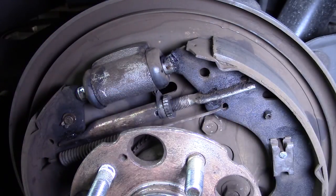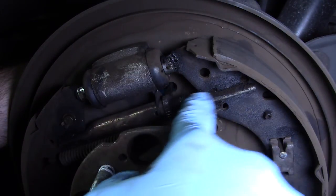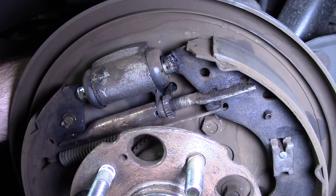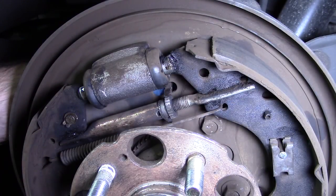If you're not able to get the brake drum off, you can see this hole right back here. This hole shouldn't be open and exposed — there should be a rubber grommet on it, but for some reason that grommet is missing. What you need to do is take that grommet off and slip a screwdriver in through there and turn the mechanism. If you turn it this way, the thread is such that it's going to move the fork out and press the shoes apart into contact with the drum. When the brakes are adjusted properly, the shoes are almost touching the drum but not quite. Since we need to get these off, we're going to back the self-adjuster down the other way — draw the fork in to make it easier to get the shoes off.